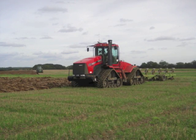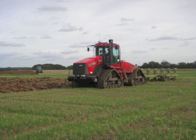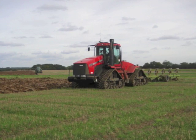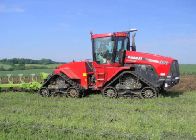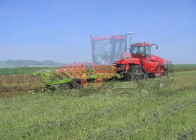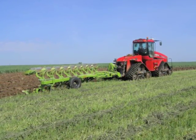I just wanted to post this clip to highlight some problems we've been having with the tracks fitted on our quad track. We fitted two new front ones recently and took the rear ones off to look at the rollers. We noticed there is some crazing in the tracks around the Kevlar coating which they now put over these new tracks to provide a lubricant between the track itself and the drive wheel.